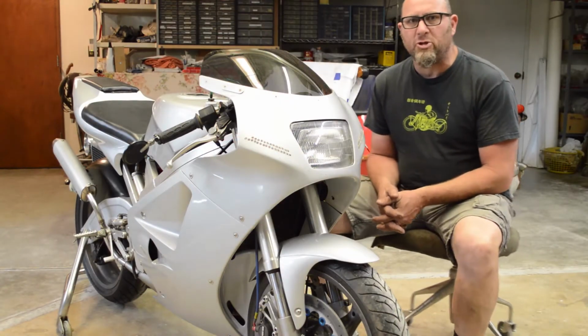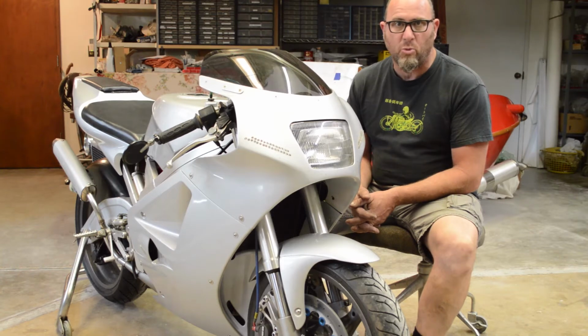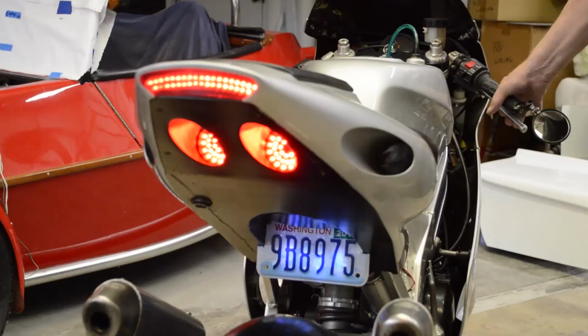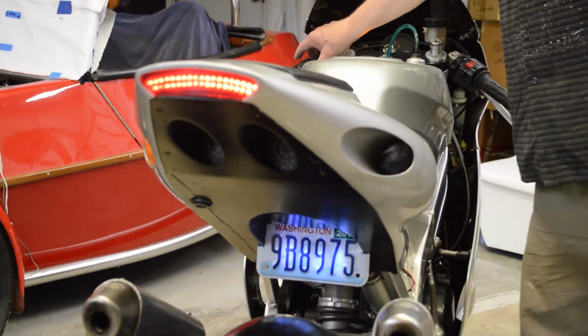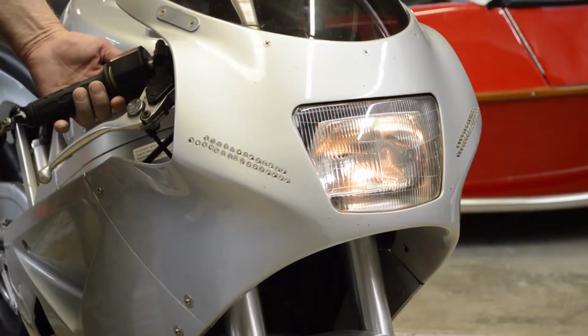Talking about the performance of the machine, I've ridden and owned multiple RZ350s, which are a power valve version, but not quite as severe porting as this. The porting for top end is really great, but by using the long chambers and smaller carbs, it keeps it super streetable. When riding it, I was thinking it was going to have more low end power than the mid that it had, and power-wise it pulls like a Kawasaki 640, a much later model bike, of course.